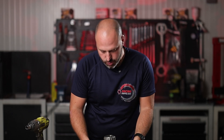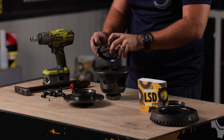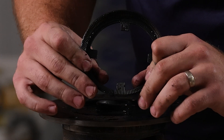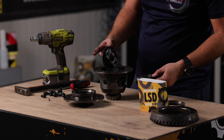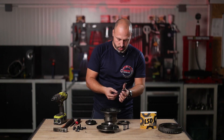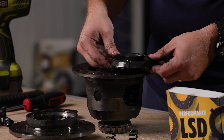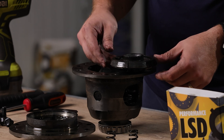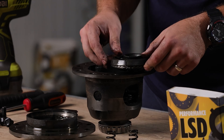When you've finished unscrewing those bolts, flip the unit back. Remove the cap and you should see the friction cone — and here is the problem, it already broke. This differential works on the friction cones and on the preload pressure provided from springs and pressure plates pushing large spider gears against each other, creating pressure on the cones. This friction creates the limited slip effect.